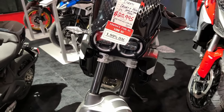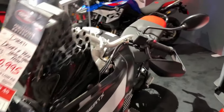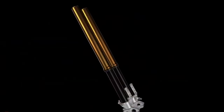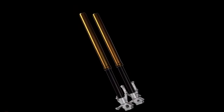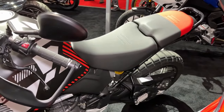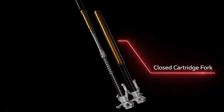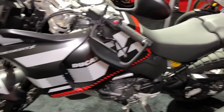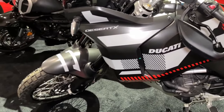There's 20mm more suspension travel at each end, bringing the overall numbers to 250mm at the front and 240mm at the rear. The front end wears new billet aluminum triples, gripping a set of closed-cartridge KYB forks that sport a Kashima coating on the uppers and a DLC coating on the lowers. There's an Öhlins steering damper in play too.